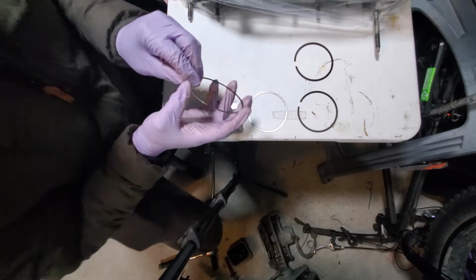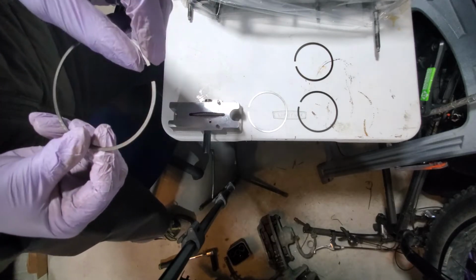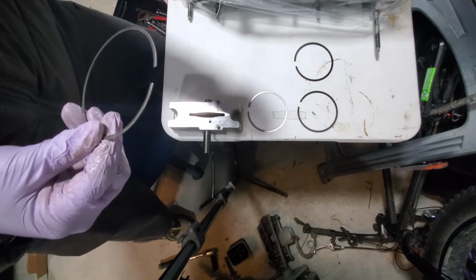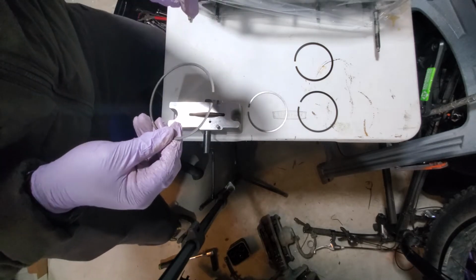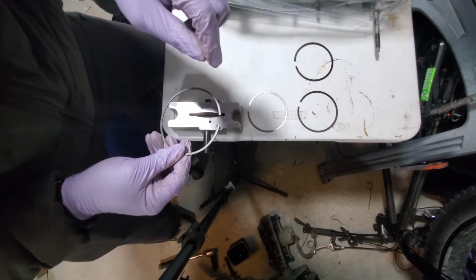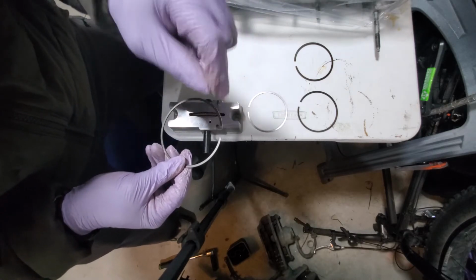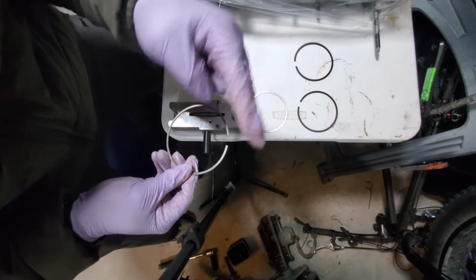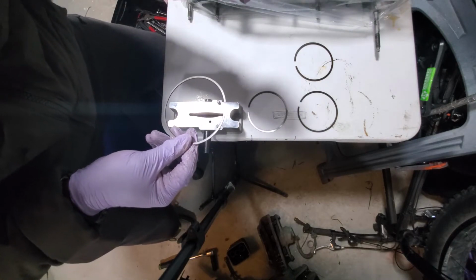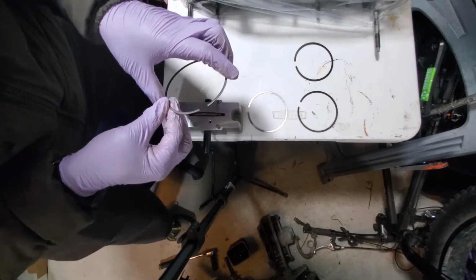All right, so with the old piston ring, the top ring, I already filed it down. Let me see which one it is, this one. So I already filed it down and got it to 0.018. So I rounded up from the 0.017, because the millimeters set was 0.445 and the millimeters set on the feeler gauge was 0.017 or 0.432. So I rounded up to the 0.018, which was 0.457, which puts me roughly in the range of where I need to be.